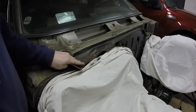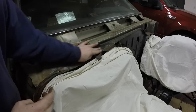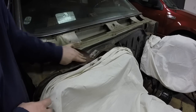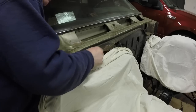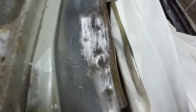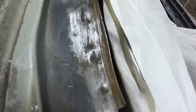I want to clean it until it's shiny. This is the time-consuming part — I want to get all the rust, paint, caulk, and everything off the joints, then prime it with zinc chromate primer, re-caulk it, and then paint it. You can see why it's time consuming just getting into all these little layers — there are many layers of metal and they all have to be sanded. You've got to get right down in there to get all that rust out.